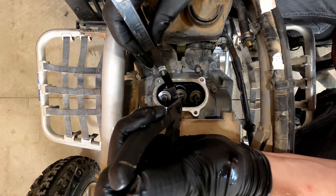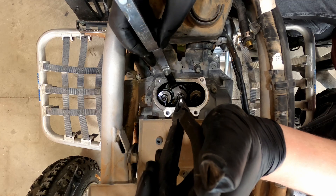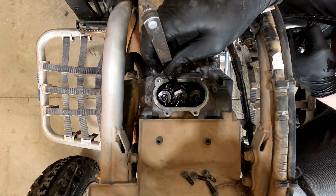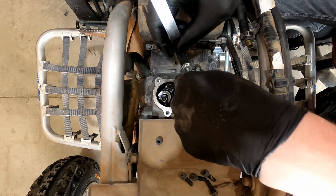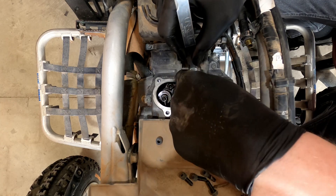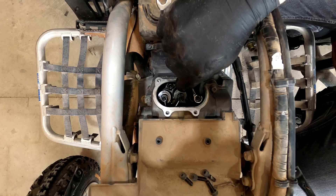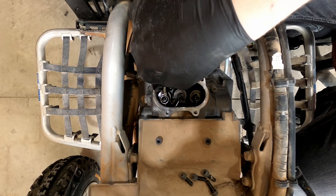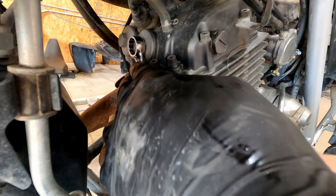Remember, these parts are moving and there's a lot of engine vibration acting upon them, so a good proper torque on the jam nut is super important, and the correct spec is super important. Over time as valves wear they get tighter as far as valve lash measurement goes, so if you had to fudge it one direction or the other, it's better to fudge a little loose versus a little too tight. But go too loose and it'll make noise and can damage the valves and the rocker arms, so really you just need to do it right.